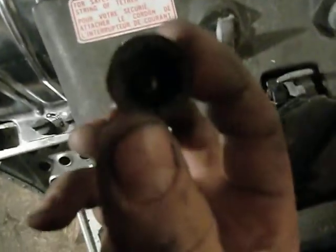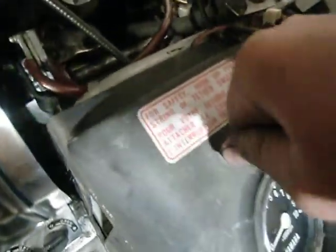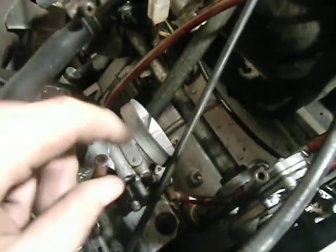So far I have everything hooked up as far as I know it was before. The kill switch doesn't work — I can't find the key so that's not hooked up either. The only thing I can switch on and off is this tether switch here, and it didn't even work before. I had to put a screw in the bottom of it — pressing this little button in a little bit further because it wasn't pressing in far enough. I also mounted the fuel pump. These look like old crappy gas lines because of the colouring, but it's actually red. These are the vent tubes — this is what happens to old gas lines, they get all hard and brittle and cracked. But this is still really rubbery, so it's still good.